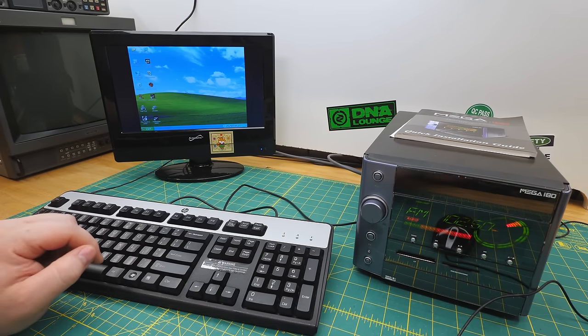Setting our opinions of the Mega as a product aside, let's now look at this as a piece of electronics. 2003 was a bit early for thumb screws. One weird thing about machines of this sort: these shuttle-type PCs often had aluminum chassis, so you expect a certain weight to it, and it just doesn't have it. Here's the machine — this is sort of the lament of the shuttle PC. They all looked like this inside: incredibly packed, incredibly miserable, very hard to work in. Besides everything being very close together, this is basically just a normal PC, with a couple of minor deltas. In order to show you those, I'm going to have to pull pretty much everything. We'll start with the CD-ROM and the hard drive.